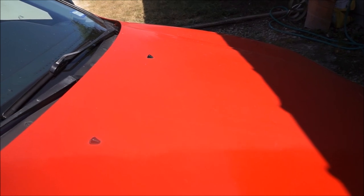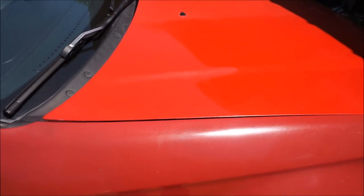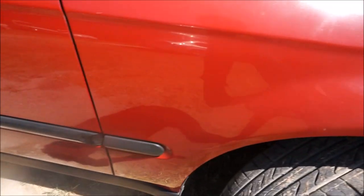I gotta say I'm impressed — this little buffer really showed me wrong. We did the buffing, stage 2, and now the polish. It doesn't come with any compounds; I'm using all Meguiar's because that's a brand I really enjoy. As you can see on this side it's very heavily oxidized — that's how we started. Pulled it out into the sunlight and there's actually some shine to it now. No swirl marks either, and thanks to that random orbital it really did good. No sandpaper so there are still some imperfections, but everything else looks really good. I'm even going to continue on the fender to show you how much more it can do.